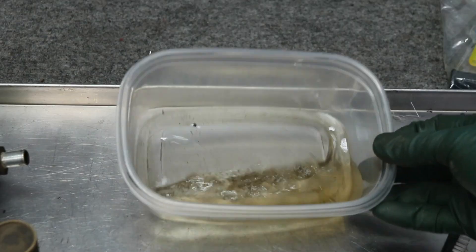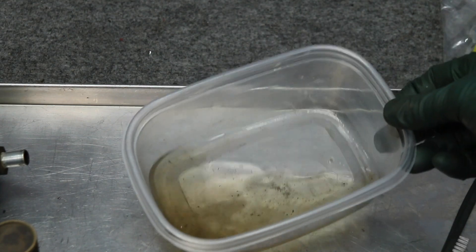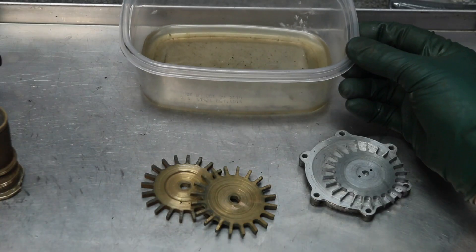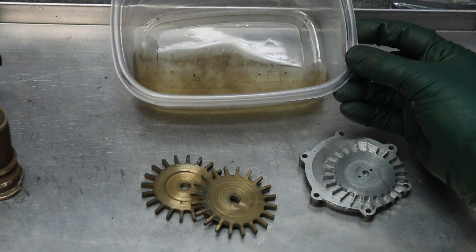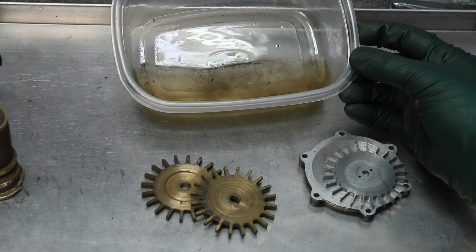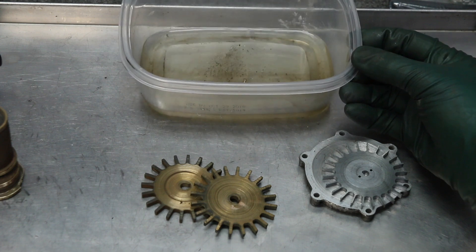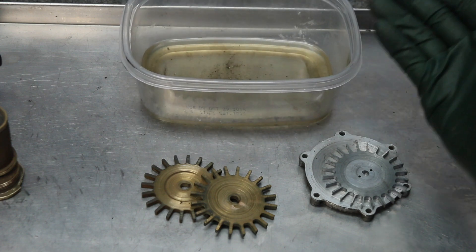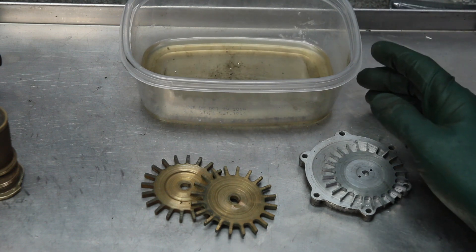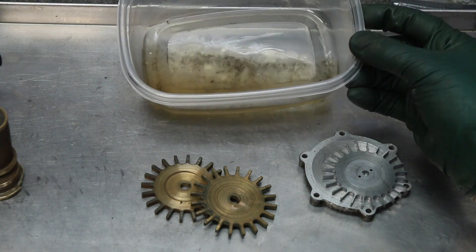Not a lot of varnish, but we got some really bad particles — and I'll tell you why these particles are so bad. Looking inside this fuel, you can see there are a lot of very fine particles. A lot of that has to do with the fuel tank corroding internally, which is so typical of cars that are 30, 40, 50, 60 years old. The fuel tanks start to rust inside and those flakes fall off.